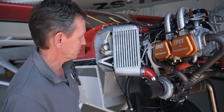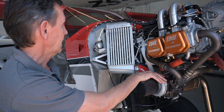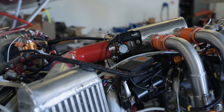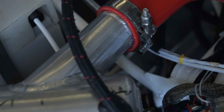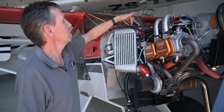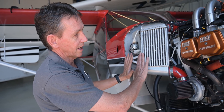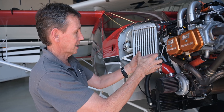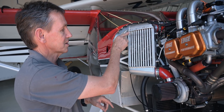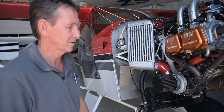The reason it's on the side is because it has to be connected to the compressor section of the turbocharger and get air into the intake manifold. Finding a place to put it inside the cowling was a bit of a challenge — we had to do some modifications to the intercooler itself so the outlet would fit nicely. On the bottom cowl we built a NACA duct, flush with the cowling, which brings fresh air in and ducts it through. The air, once it's done its job of cooling through the intercooler, will escape down through the back and out at the back of the cowling.